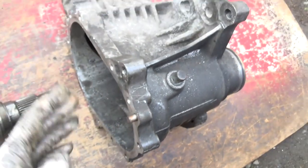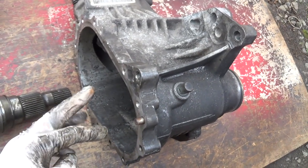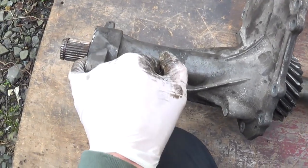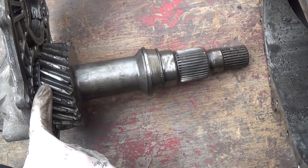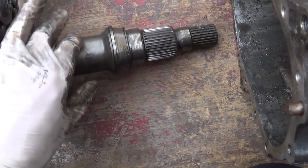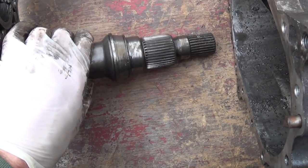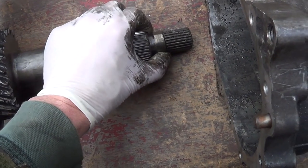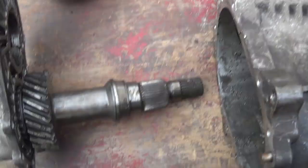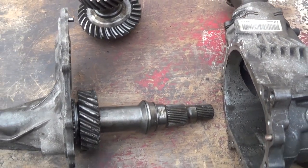So there's no oil needed in this box anymore, because there's a steel bearing at this end, and this shaft isn't going to turn. I'm going to replace this bearing just to make sure this is held in the correct position, and all it does is support the end of this shaft. I'll come back again when I've got it screwed together.